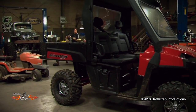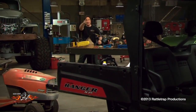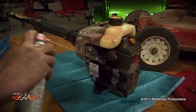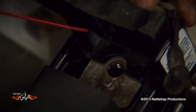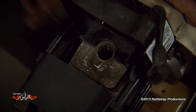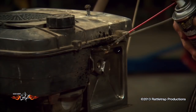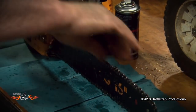That takes care of most of your general maintenance. When you want to store something for a few months, like over the winter, here are the steps: drain or treat the fuel system, change the oil, spray the engine down with degreaser to get all the goo, gunk, dirt, and grass off, then pull out the spark plug and squirt in about an ounce of oil and rotate the engine. Replace the plug — this coats the cylinder walls with oil to prevent rust or corrosion. Finally, remove the battery if it has one, and lube the throttle linkage, the chain, or any other moving parts so they'll be ready to go in the spring.